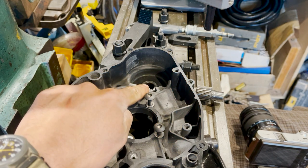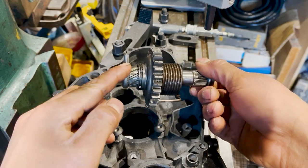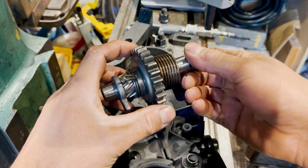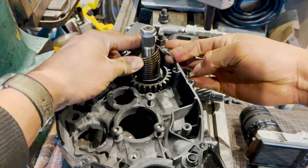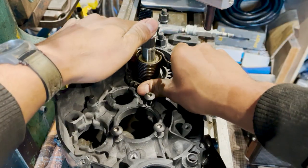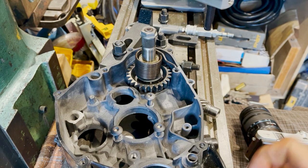Now that we have our bush in there turned down to the correct height and reinstalled in the case, the next thing to do is install the new kickstart mechanism. This is an entirely new kickstart mechanism - I wouldn't even bother trying to repair the old one. This shaft is hardened steel, that's cast steel - it's just not worth repairing it. The fear of it breaking again, it just wouldn't be worth the risk. You can see this little retaining kick here at the bottom goes into that slot. I'll just drop it in, pull the tension spring around into its hole - and that's it, that's ready to go. In terms of fabrication, repairs and machining on this case, I think that's pretty much it. Next step is to give this a good clean, remove all the old bearings - I think we're finally ready to start reassembling this engine with new parts.